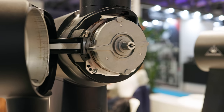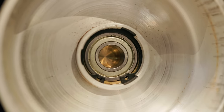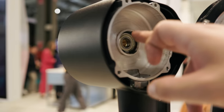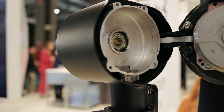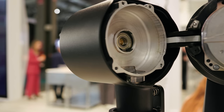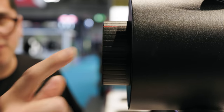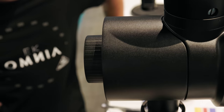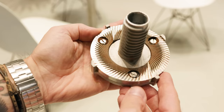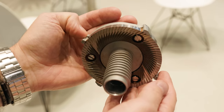But that's not even the most exciting part. They have added a bearing to the front part of the axle. In the standard EK43, there is no bearing at the front — a big failure in my opinion. They had bearings behind the burr set and at the back of the motor, but not at the front, which allows the front to move freely and makes alignment unrepeatable. In this new setup, they have optimized the potential for alignment. On top of that, they check alignment before it leaves the factory with a dial indicator, ensuring quality control addresses past accusations of misalignment.